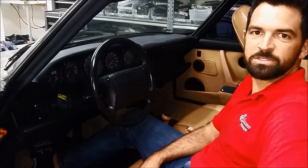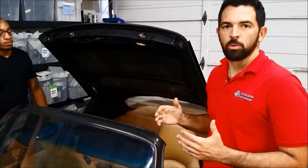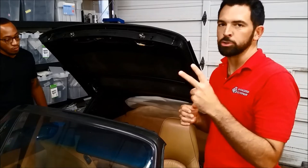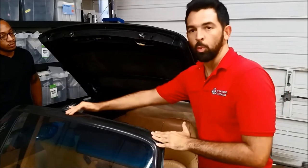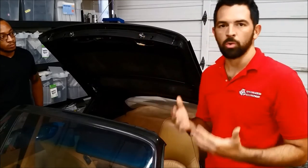So let's talk about the micro switches. The micro switches we're going to be testing are the ones on the frame of the convertible top system. You should know that there are two sets of micro switches here: the ones that tell that the convertible top already reached the windshield frame of the car, and the internal ones of these latching motors.